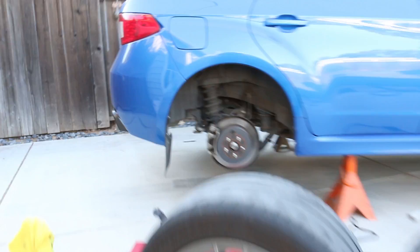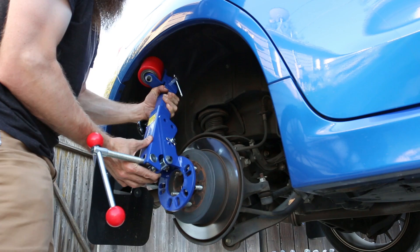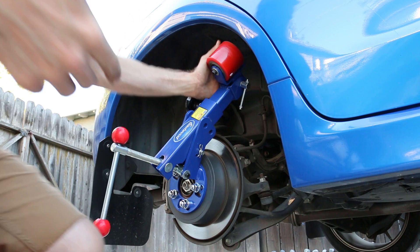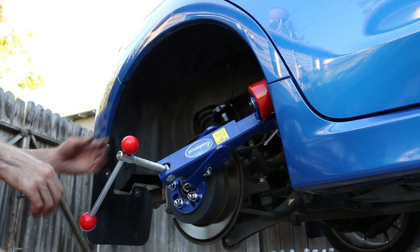We're gonna take the fender roller — it has a few spacers — and go ahead and put that on the hub. Make sure you don't whack anything with it, get it into the appropriate holes, and put that on there. Take the e-brake off and put the spacers on. Once you get those bolts mounted up with their little spacer washers, take the e-brake off so you can roll the hub freely and then adjust the tool.